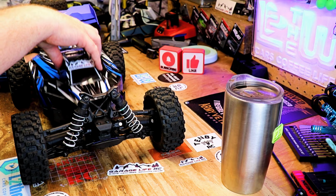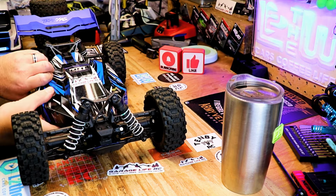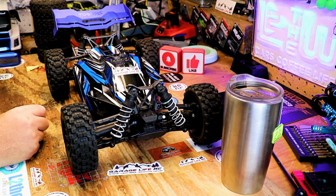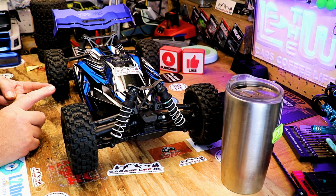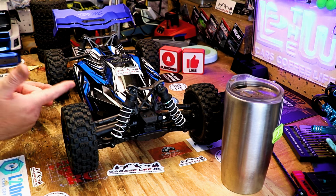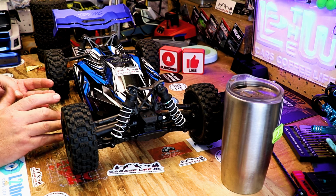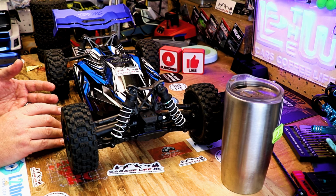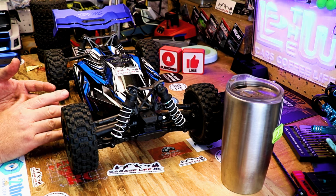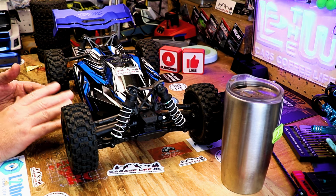And yes, I know some people said, oh, after all this stuff, you'd be better off with the VXL. And, you know, some quick math. Yeah, I got probably about 520 or so into this now, because we got 80 bucks for the ESC. It was 35 for the metal hexes. It was like 10 bucks for the drive shaft, which I still say I don't think you totally need. And then what was it, $60 to $70 for the center diff. Now, if you stay on 3S, like I believe I mentioned earlier, I think you're fine with the slipper clutch. But if you're going to go 4S, you're definitely going to need that center diff.